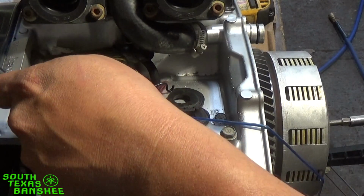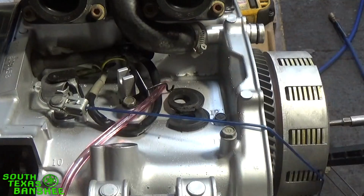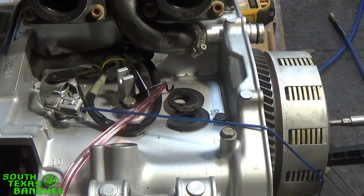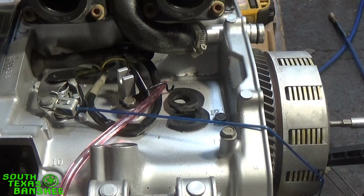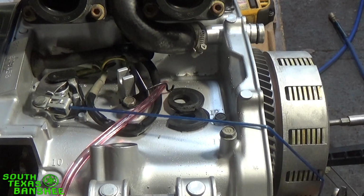So see here where right now we're kind of out of line with these triangles. So all you're gonna do is screw in on this screw. Let me climb up here and see the screwdriver turning. Yeah, see, I'm gonna screw in on this, and see now it moves those 2 arrows together. Now see, that would be too far out.